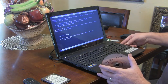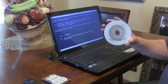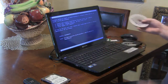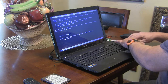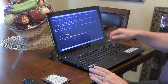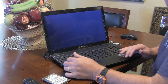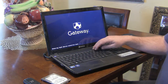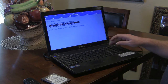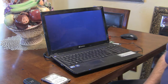I have a trusty Windows 7 Home 64-bit machine, but I got a Pro CD — I just burned a quick one from an OEM ISO image. I rebooted it, turned on the F12 menu to allow booting to a device, and selected the Opti-Arc DVD instead of the Western Digital drive.